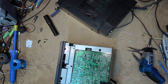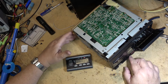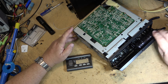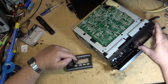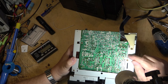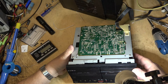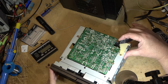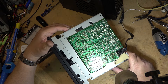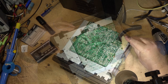The board's on top. One deck is a little bit sharp and the other is a little bit flat, so we need to get them both going the same speed. There are speed control trimmers labeled 'A motor high and low' and 'B motor high and low.' I don't even need to get into the back of the motor — I can adjust them right on the board itself. B low speed is R504.